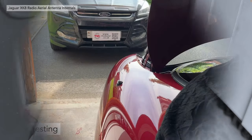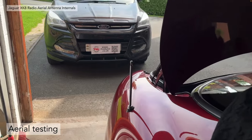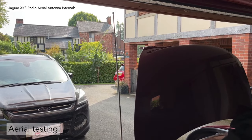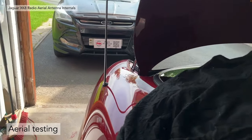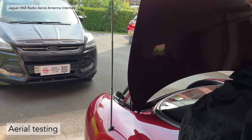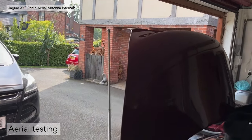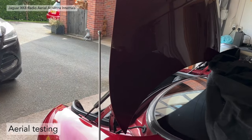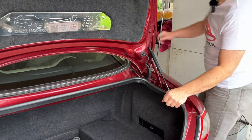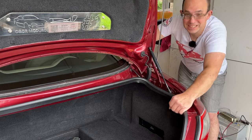The testing then. I was very surprised — the aerial before I did this was refusing to come all the way up. I had tried WD-40 on the outside but that wasn't successful. But now, as soon as I've greased the internals, the aerial came up without any issue, and also retracted all the way down. There you go — it's retracting, retracting, retracting — success. All done, all back together, and the aerial is extending as it should.